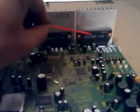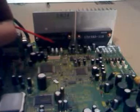What happens is over time — six, eight, or ten years — the thermal paste behind these convergence ICs tends to deteriorate in quality. When that happens, the ICs reach what's called thermal runaway. Then you run into problems like you ran into and start Googling or looking on YouTube.